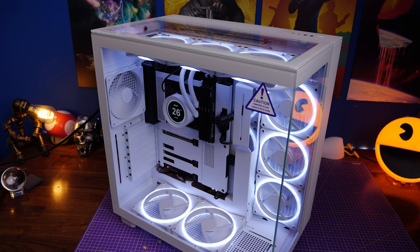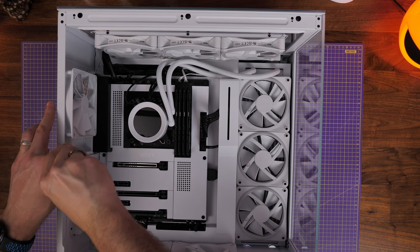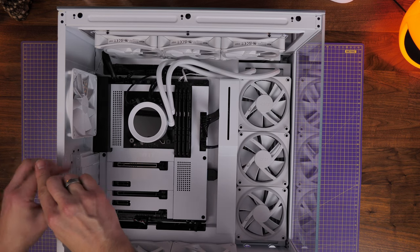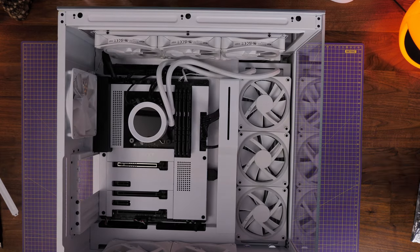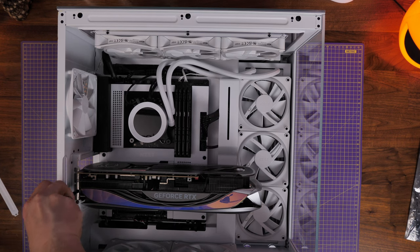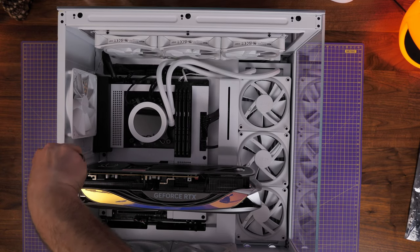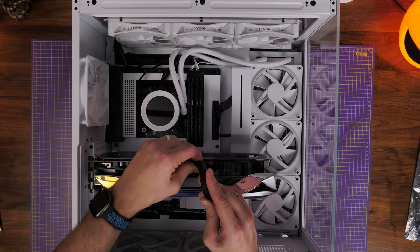The H9 Elite is pretty huge — I'm using an RTX 4080 from Zotac which is quite chunky and lengthy. It will take the 40 series easily. It's a three slot card so remove all those back plates before installing — it pops into place going nearly all the way across the front, almost covering some of those front fans. I'm going to show you an optional vertical mounting bracket as well, which gives a much nicer look if you've got a particularly nice GPU.